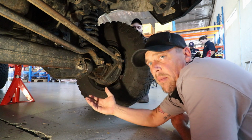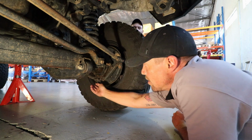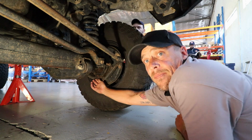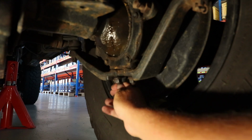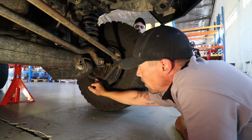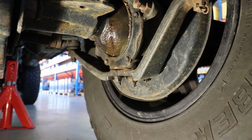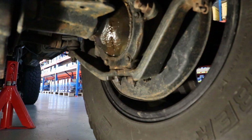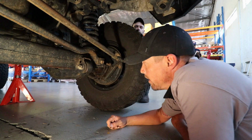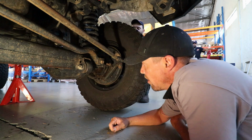It's staying in place, but once we've lifted the vehicle, these bolts underneath the steering knuckle arm, have a look at that. They finger loose. If we wiggle it, you can see the whole arm is loose. Maybe another 100 k's on corrugated road, who knows, maybe 10, this would have all come off and who knows what would have happened. Just something to check going forward.